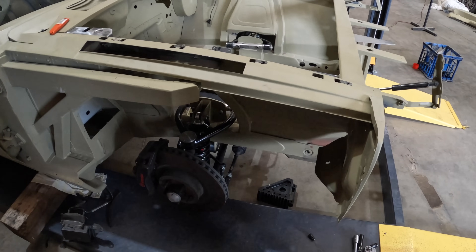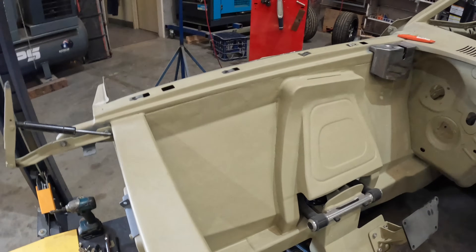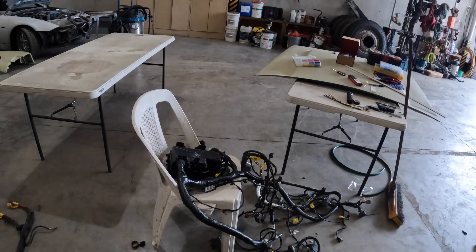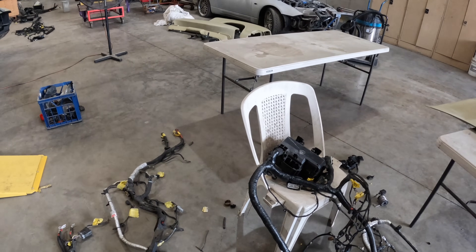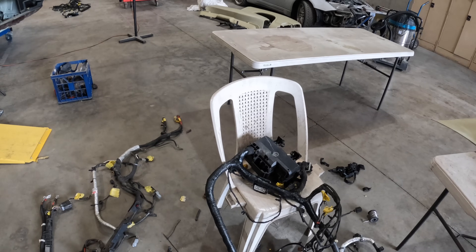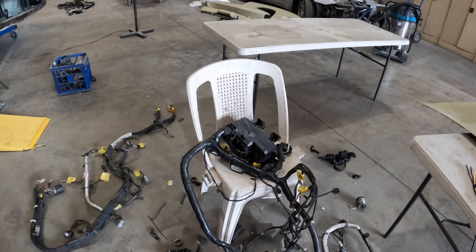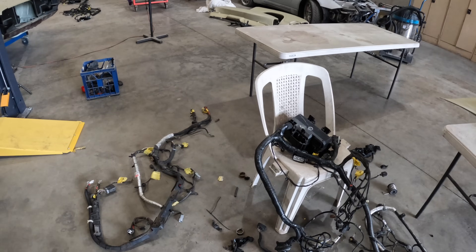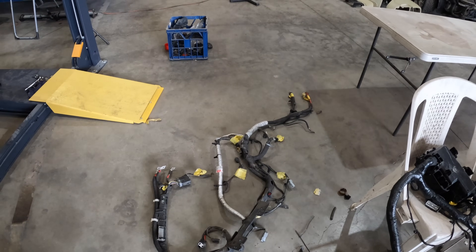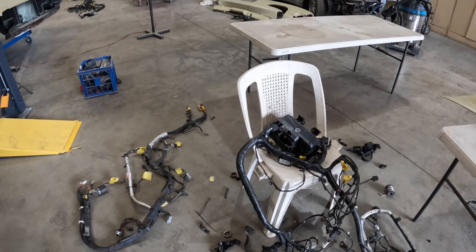I think my idea of putting the fuse box at the front is not going to be pretty. There's not enough room to hide it in the wheel well, which would probably be a very bad idea anyway. If I do put it in the engine bay, it's basically going to be sticking right out here — I don't like that idea. My next idea is: can I put the fuse box in the boot? If I could manage it, the final outcome would be a lot better. The engine bay would be cleaner, and since I'm already relocating the battery to the boot area, I think it would be a great idea if I can pull it off. I wanted to try to do this myself without involving auto electricians, though I'm not guaranteeing that at this stage. So if all else fails, I'll probably call in some help. I think I might mock it up and just get an idea of what's what and what has to stay or go if I was to move the fuse box to the boot.